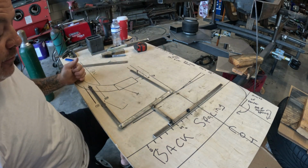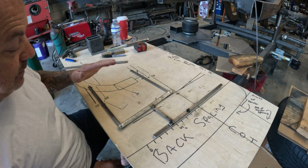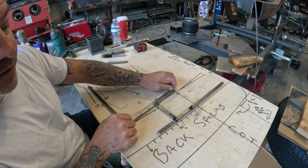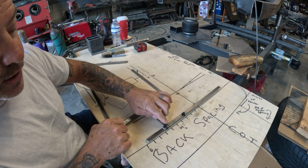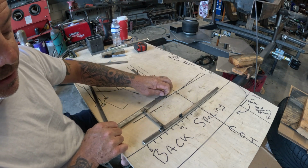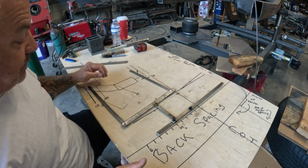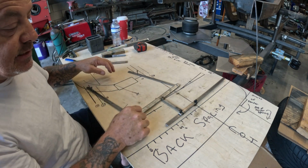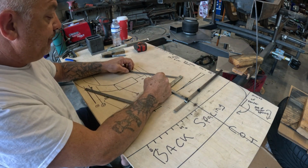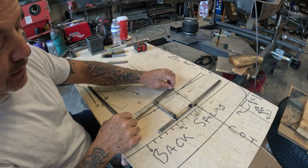So at roughly 5 inches of travel, our lower control arm is parallel to the ground, and you could see that the arc is very subtle. Now, granted, these are 1 inch marks. I'm moving it quite a bit, 2 inches of stroke. I still don't like it. So what I can do is fine tune my settings here and see how I can get this to work a little smoother. We'll move it back a hole, and we're going to try it again.